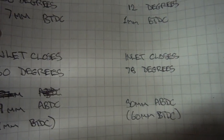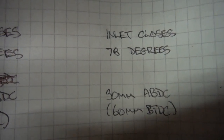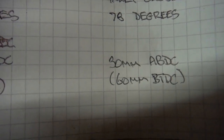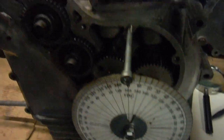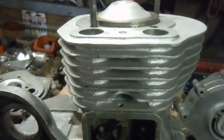Going down to the inlet closing: we've got 78 degrees after bottom dead center instead of 60, and that translates to 30 millimeters after bottom dead center as opposed to 19 — a difference of 11 millimeters at that end of the stroke. That is 60 millimeters before top dead center as opposed to 71. So the piston has moved up the bore an extra 11 millimeters on the compression stroke before the inlet valve shuts, which is well over 10 percent of the capacity, given a 90 millimeter stroke for the 350.